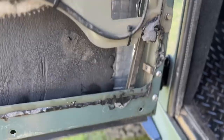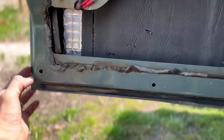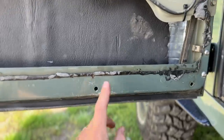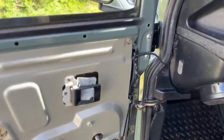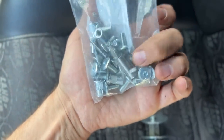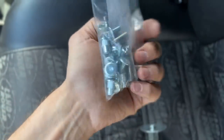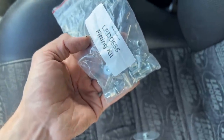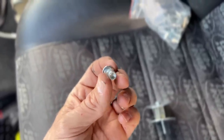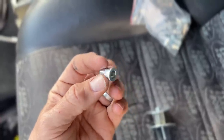I sound like I know what I'm doing a little bit more because I've actually done the other door before filming this video. Old plugs are out across the bottom and sides. You need a nine millimetre drill bit — that's what Powerful UK recommend and I agree. I'm using an 8.5mm and making it slightly larger so I can hammer the rivnuts in for a better finish. The kit comes with furniture bolts, extenders, and threaded bars.